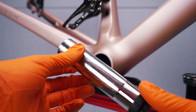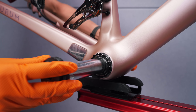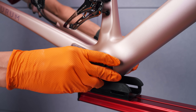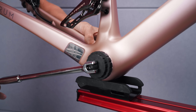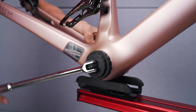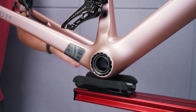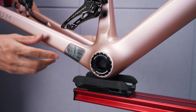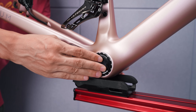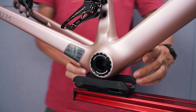There I had also gotten the Token installation tool for the BB, which made it very easy to install. To start with, I threaded it together by hand until both cups were touching the frame. Then I used a 3/8 socket lever to get the cups flush with the frame, then finished off with the torque wrench to the specified 25 to 30 Nm. On with the 24mm adapters, which are very nicely built with rubber seals both internally and externally — but they are pretty hefty, and that is basically why this BB is on the heavier side of the spectrum.